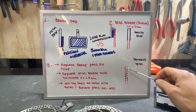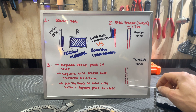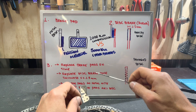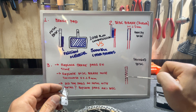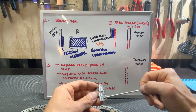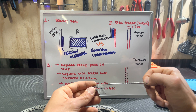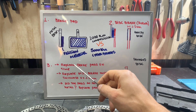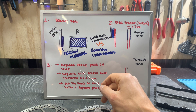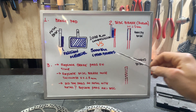On a damaged disc, the disc becomes concave, so you lose contact ability between the brake pad and the disc. In this case the metal base plate material starts to penetrate and groove the disc, reducing its thickness even further and reducing your ability to stop the bike securely. If an accident is about to happen when your brake pads are in this condition, you will not be able to stop and avoid the crash.